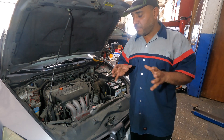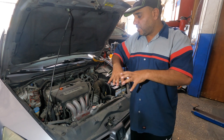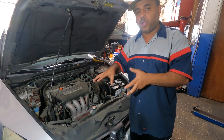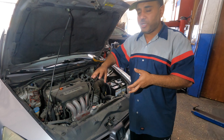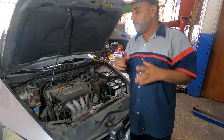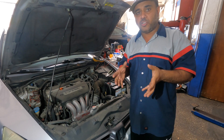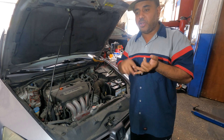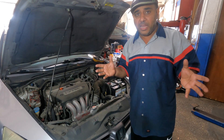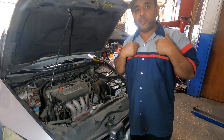This is only to test the AC compressor. I would tap it, let the compressor come on — this eliminates pressure and everything. Once you put that on, the compressor will come on, your AC line should get cold. All you do is remove it after two or three seconds and feel the line. If the line is cold, that means you have pressure, your compressor is good. It will rule out compressor issues and confirm good freon. But you can't leave it on too long — it will blow the system. This is only for test purposes, so be careful.